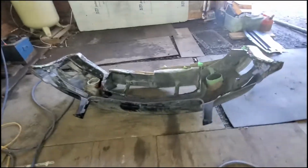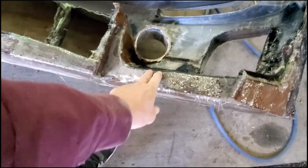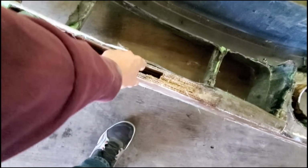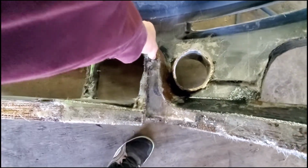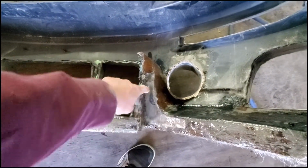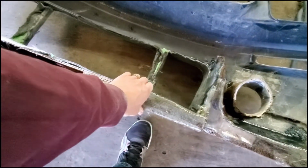the bumper. This is the front bumper. We had to do some repair work to the front bumper. So now this is all fiberglass. These 2 pieces are closed up. This is actually a piece of cardboard. It's real thick cardboard, and that's the bottom section. So this is the back. This comes up here, wraps around. This is where our bracket is going to go to the body here, which will hold for that. So once we sand all this down, this will be super strong, super rigid.